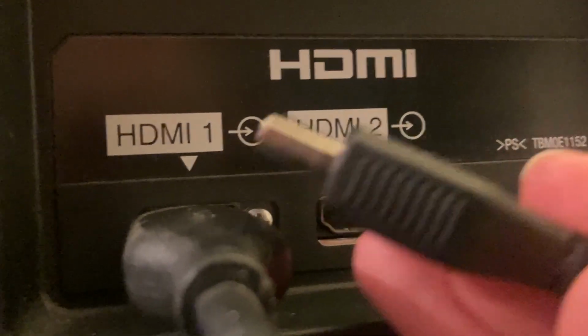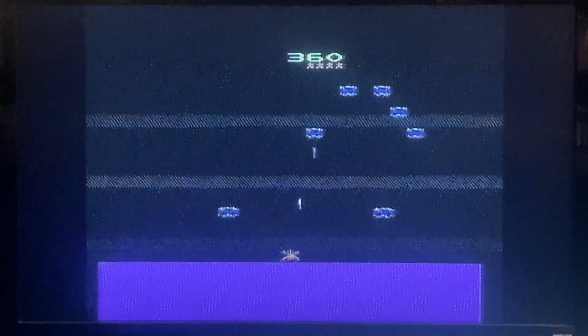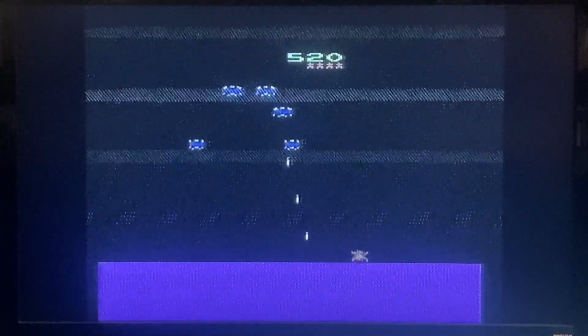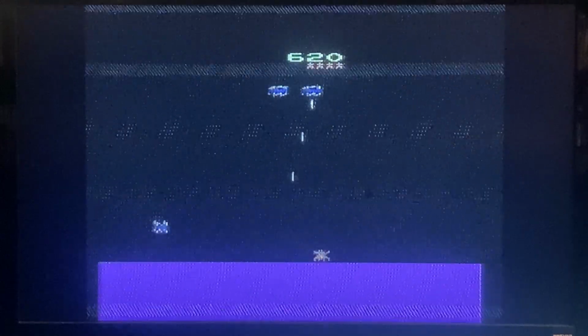A line doubler, such as the fantastic RetroTink 2X products, doubles the resolution, so you get a much cleaner image on a modern display, and it also outputs to HDMI, which is especially useful for capture cards. Although given how dirty the original cable is, those initial imperfections are going to be doubled as well. Still, this is about as good as it gets using original hardware without modifications.